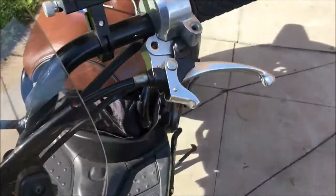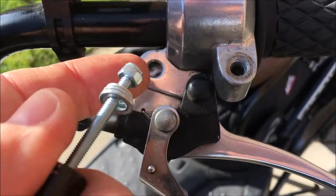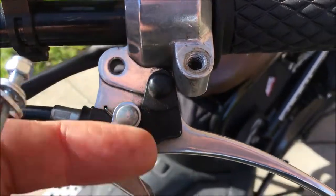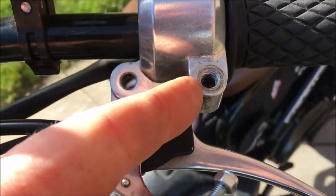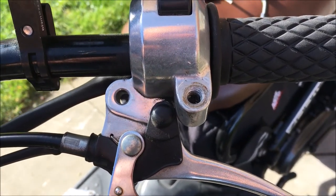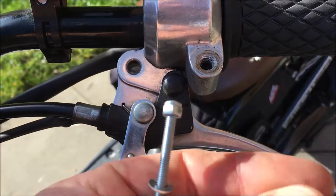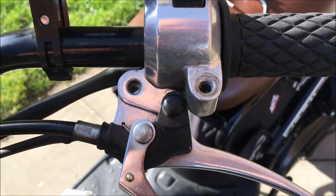The problem is I'm going to have to do exactly the same over here, because although this thread isn't cleared, I can't really just screw them in, because then one's going to be higher than the other and that's going to look a bit odd. So we're going to pack this out with steel stick, drill a hole, thread the bolt through, thread the bolt underneath. It's a bit of a faff, but I only need to get the stock mirrors back. The steel stick is just an epoxy resin compound you mix together in your fingers and pack in there.